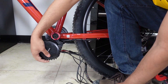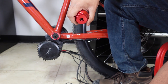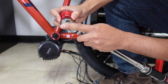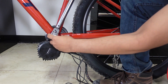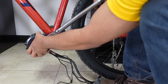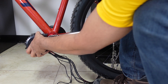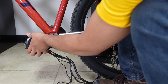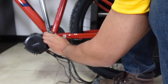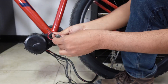The motor's good. Now I'm just going to torque it down. Lecky has these tools which can be used instead of the Bafang installation tool — this one you can actually use on a torque wrench. So I'm tightening it down now to the specific newton meters of torque.